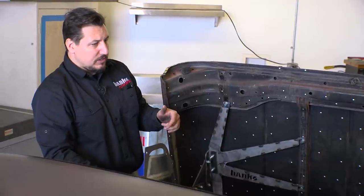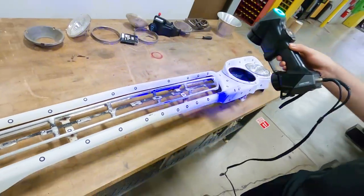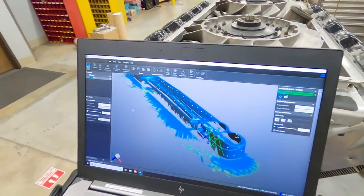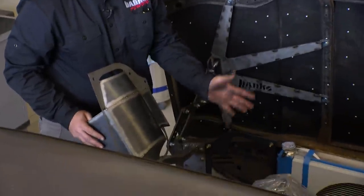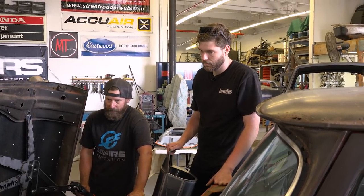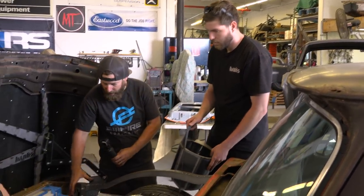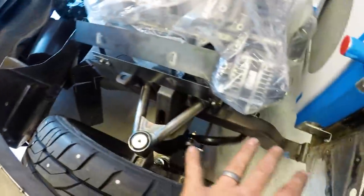We switched from the '66 grill this thing had into a '60 grill — the dual headlights. We're taking the inner headlight out and there's going to be a five-inch tube right here that meets up with a radius entry in that headlight. The filter flange sits right on this, so all of this area up top is clear and open now. Before, when it was rear entry — we switched the supercharger around — everything was going to come up around the front. Now it's much simpler: it's a single-bend piece of five-inch that's going to dive down into where the filter is going to be.